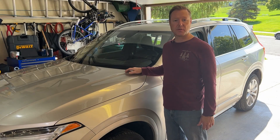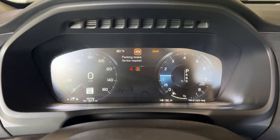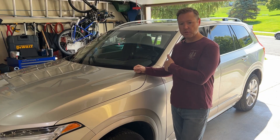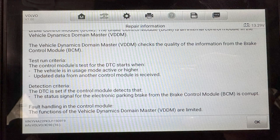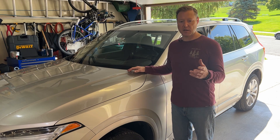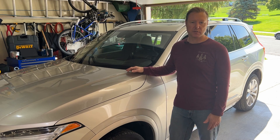I'm trying to diagnose and solve a problem. The parking brake won't engage and it says parking brake service required. When you hook it up to the code reader, there's an issue with the right rear parking brake motor. Previously it had messages about the VDDM - Vehicle Dynamics Domain Master. I took it to Volvo, they got people from Sweden involved, and they said you've got to replace that VDDM module.